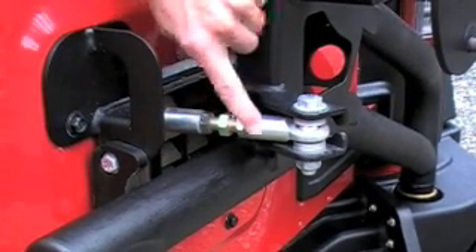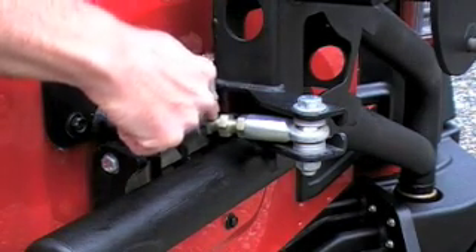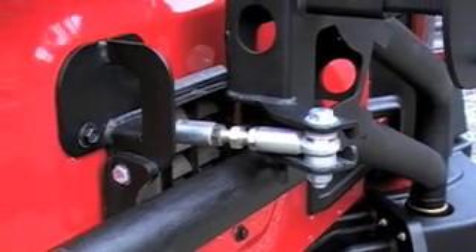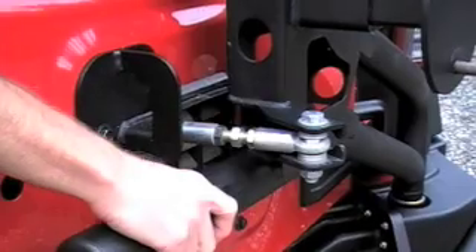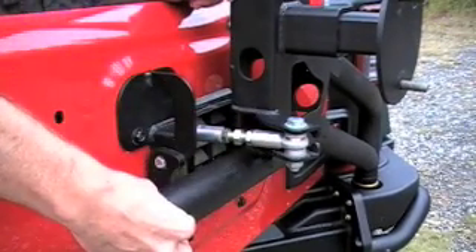You may see tie rod connections in other manufacturers' bumpers, but you'll notice that when the tailgate is closed, they wind up parallel to the tailgate. That allows no adjustment whatsoever and no ability to control preload or tension between the cradle and the primary support tube.